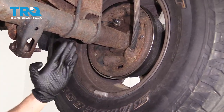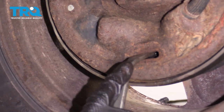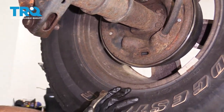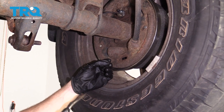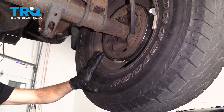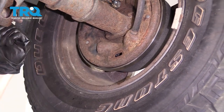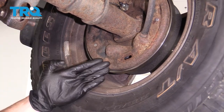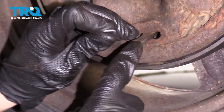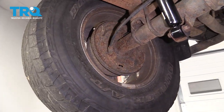Now the next thing we want to do is hop over to each of the wheels and adjust up the drum brakes. I'm just going to use my adjustment tool, come right in onto that lever, and give it a couple of cranks. While I'm doing that, I'll pause every once in a while and spin the wheel. Once I feel a little bit of drag on the wheel, I'm going to stop there and de-adjust it just a couple clicks so I don't hear very much drag at all, then move over and do the same to the other side. As the brakes heat up, they're going to expand and increase drag — if you leave too much drag on the wheel, you're going to have seized brakes after driving down the road. De-adjust just a couple clicks until you have minimal drag. Make sure you put in your rubber plug. Apply some red thread locker to all the bolts.